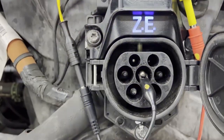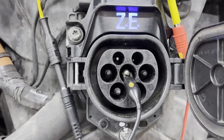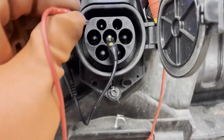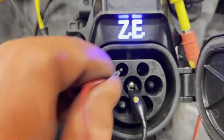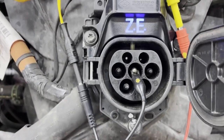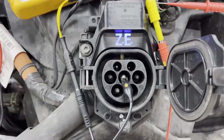The lock pin engages in the picture, and then pressing the unlock button on the vehicle remote disengages it. The debris was the reason the pin wouldn't engage — this test just confirms PP to PE functionality. That verifies the PP/PE circuit and also that the charger responds accordingly. Measuring lock pin actuator current and position with the scope verifies those circuits as well.